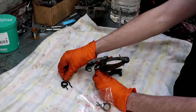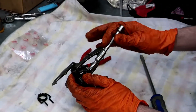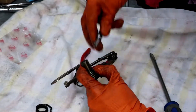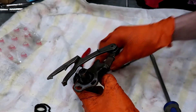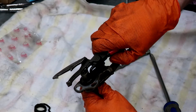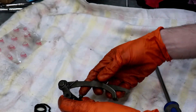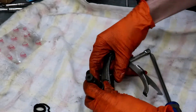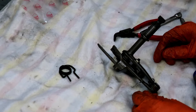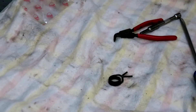Luckily I was able to diagnose this before we started working on it, so I happened to be able to order a new spring. We can just whack it in — no need to wait. A little bit of pressure to get the thing in place, the plate goes back on, and the clip holds it there. We need to check that secondary spring up the top — it should give us a nice return action for that hook. When the spring is in place you should get a back and forth motion, which translates to the up and down motion of the actual gear lever. It just works on mechanical advantage and spring tension.